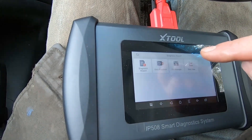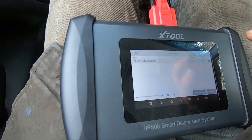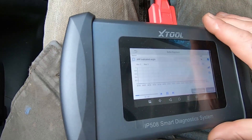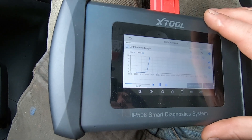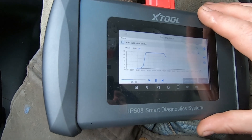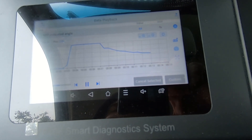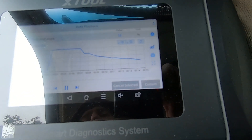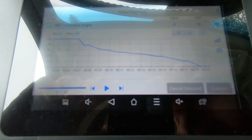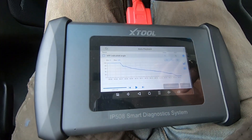Now if I go into report, I can go into data playback, and I can play back the data that we just captured. And here it is — we should probably see, yeah, that was when I did not so gently press the throttle to get it to 100%, but here we should see the gradual decline. And so this would suggest to me that the sensors are fine. That edge right there and that edge at the start — that was my not-so-careful activating of the pedal. So it's kind of neat: you can record the data and play it back later.